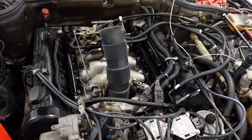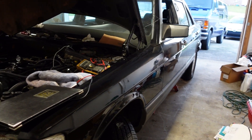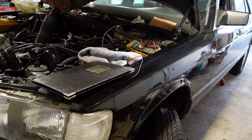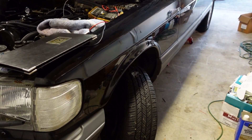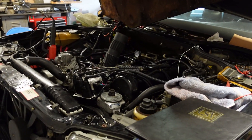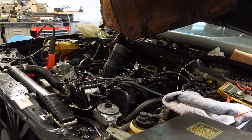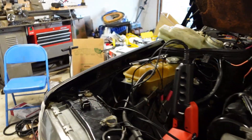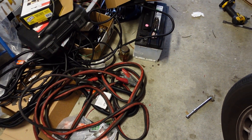I'll try to start it again after I dry off all the gasoline on the intake manifold. Apparently the starter is bad since the last time I tried to start it with the bad injectors. I put the new injectors in and tried to start the car, and it turned over really slow, almost like the battery is dead. I let the charger sit on it for a while and it still cranked the same way. I even put really big jumper cables to an extra battery.